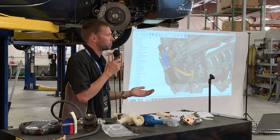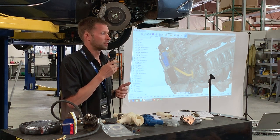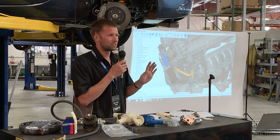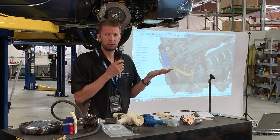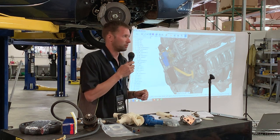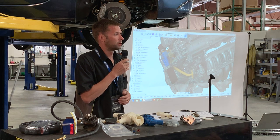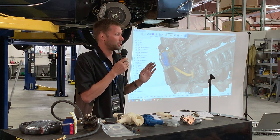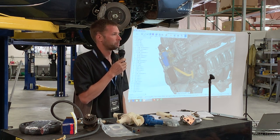So when I'm talking to people about a turbo install, make sure you do the cheap and easy stuff. A 70-30 mix is on that list. Make sure you do a 70-30 mix as long as it's okay for your winter conditions. And that's still good to like 0 degrees Fahrenheit or something, maybe 10 degrees. It's cold. It's definitely well below freezing. And that'll give you the lubrication for the pump as well. So if you're running track and you need the best possible cooling and you don't care about freezing, run water with a bottle of water wetter.